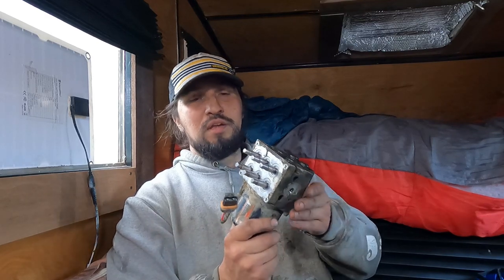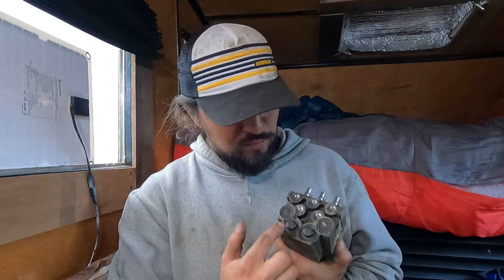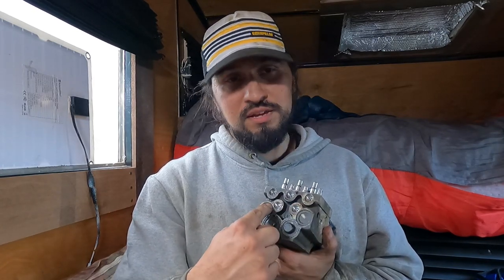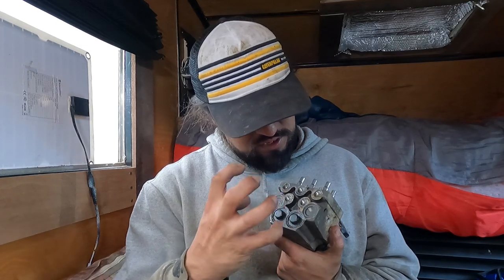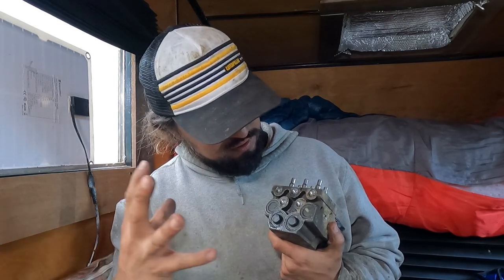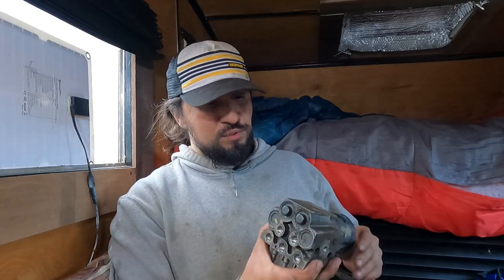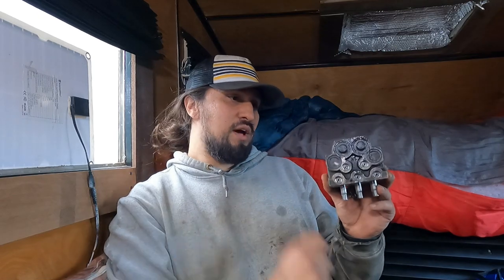It's a pretty easy unit to change. Just to get you a head start: there are five brake lines, and this is probably the most delicate part. These are very soft aluminum where the brake lines thread in, and the brake lines themselves are very hard metal. If you cross-thread this you will destroy the threads and there's no way to tap it far enough before you hit the valve body. I've done it before on one that needed replacement anyway, but do not cross-thread these or you will cost yourself a brand new unit.